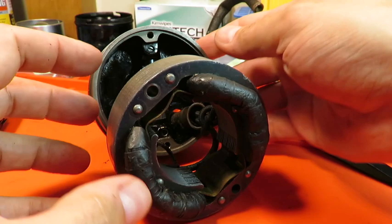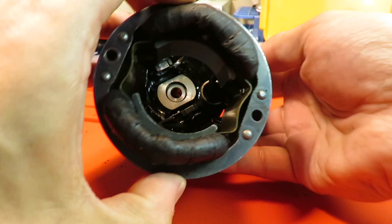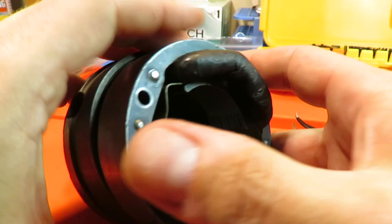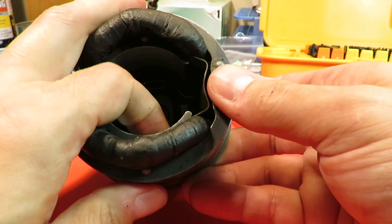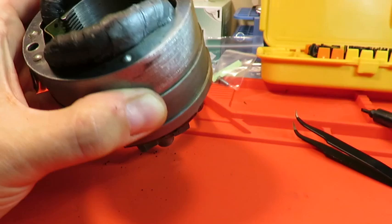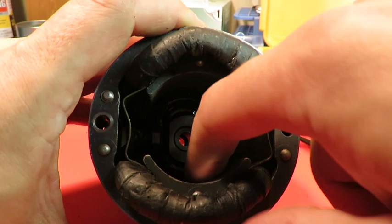And then the thing to do is get these back together so that there are no wires obstructing the path of the commutator. So I'm going to pull the main wire out and fit these back together nicely like so, and push wires inwardly out of the way and get some light in there for you to be able to see. There we are. There's a little wire there. There's a wire there. It's behind the field core. I think I'd rather that orientation, so I'm going to push that wire back behind the field core, and I think we're good to go.